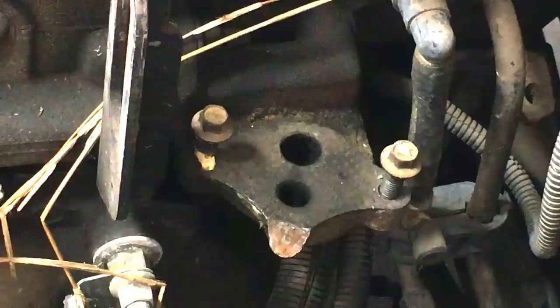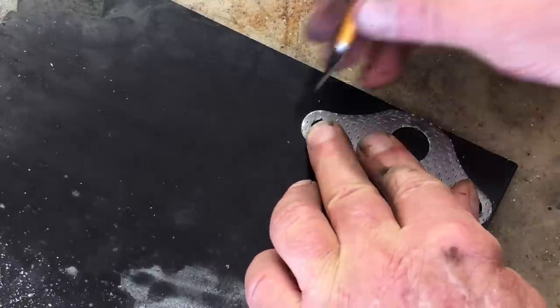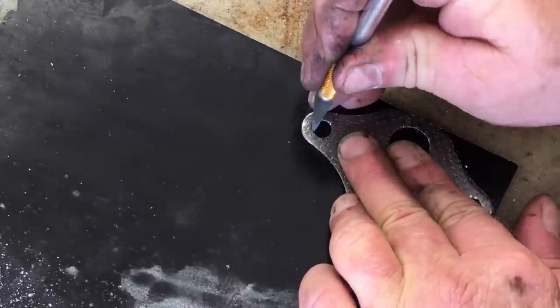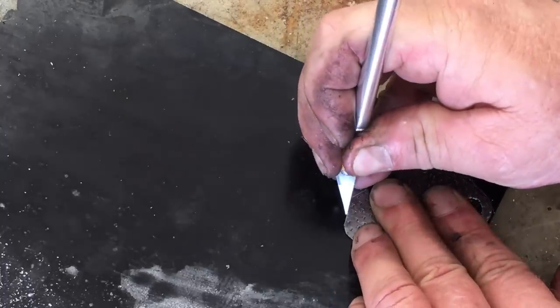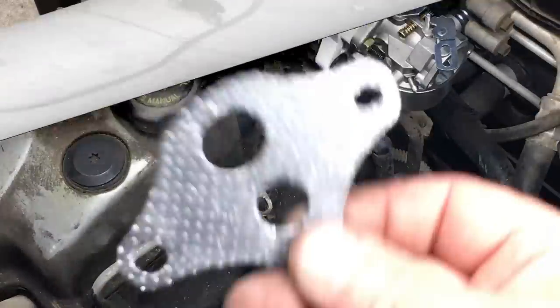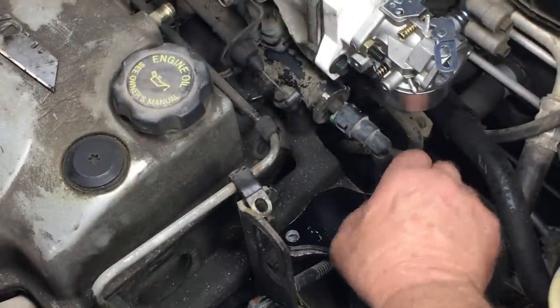We're almost there, but before we can start the engine with the carburetor, we need to block off the missing EGR valve. We'll make a blocking plate by using the EGR gasket and some 6061 aluminum. Nope. Unfortunately, on this part, we can't 3D print it. It ain't pretty, but it'll work. Keep in mind, the EGR valve was missing and that's why we're blocking it off. For this experiment, there's no reason to take the EGR valve off the engine.